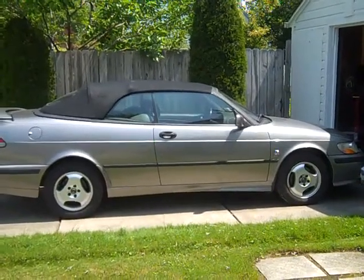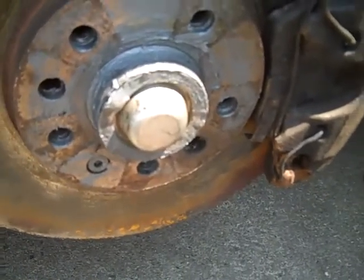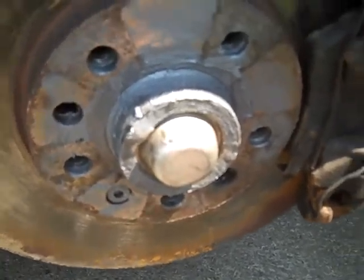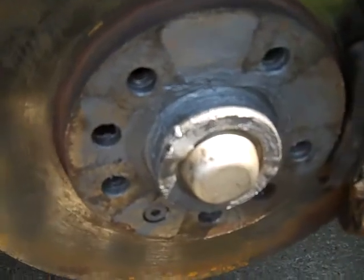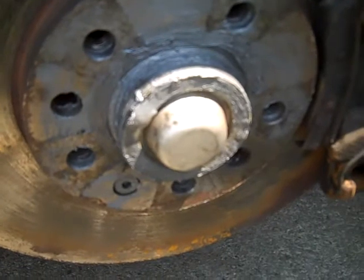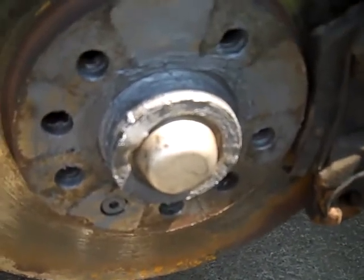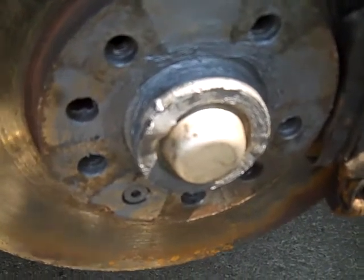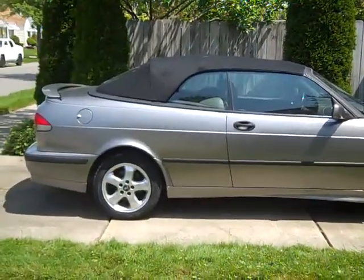Dead center, all balanced, ready to go — looking good. Just got the car with the winter wheels and snow tires on it. A little tip for northern areas: over the years I've found that alloy wheels — not steel ones — will seize onto the hub if they're on for a while, and they can be a bear to get off. You end up having to hit the back of the wheel with a big five-pound hammer and risk damaging the wheel bearing. So a nice easy preventative is a little Never-Seez right on the hub.